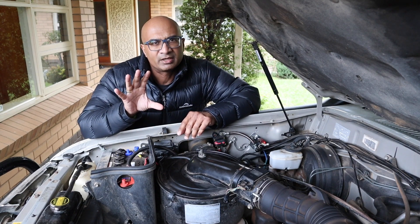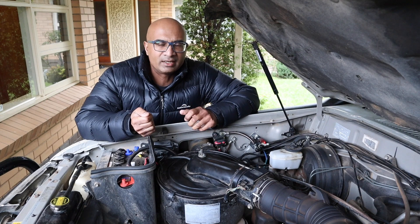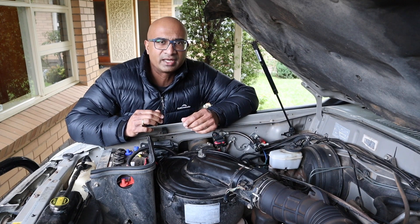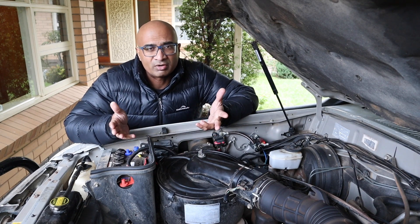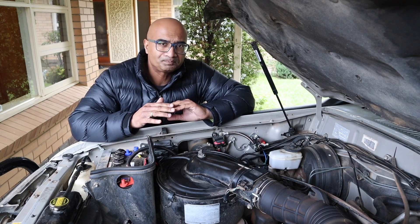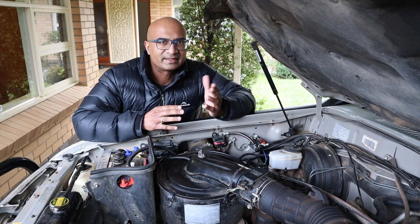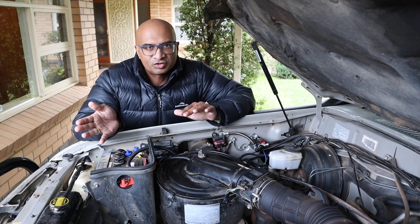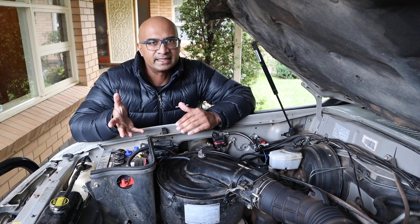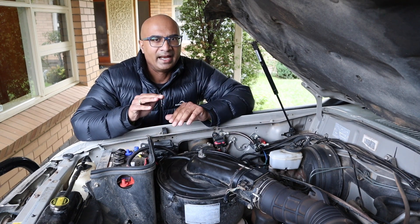The solenoid has worked well, but it's not good enough because of how the two batteries differ. The cranking battery is designed to take a quick charge and deliver a quick discharge for the high amperage needed during cranking. But for accessories like running your fridge overnight at a campsite or camping lights while cooking, you need a deep cycle battery, which supplies power over many hours. Deep cycle batteries are designed to take a slow, long charge and deliver a slow, long discharge — completely different from a cranking battery.